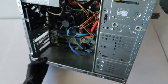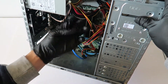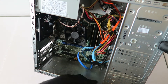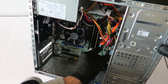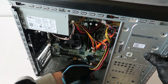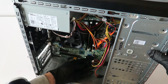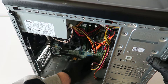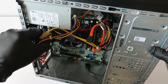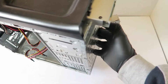You have to disconnect the cable to the motherboard — the front panel connector in the corner — and the USB 3.0 right here. Disconnect all the SATA cables, and the USB 3.0 cable has a little secure clip in the middle that you have to press to release the lock. That goes to the front — it should come out.